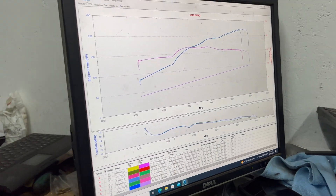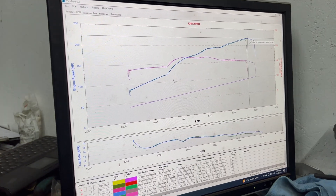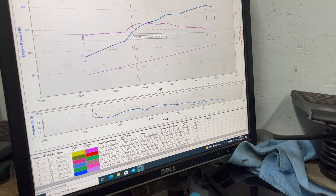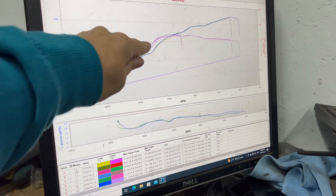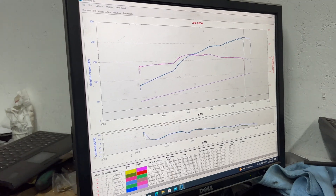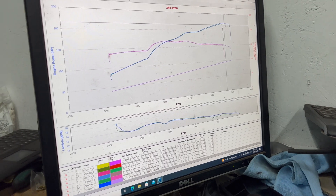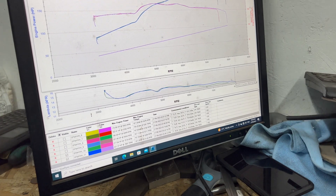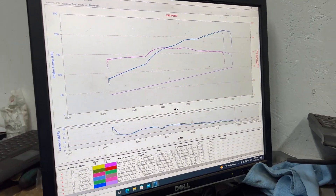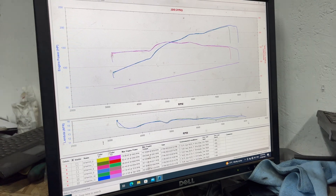Might get to 230 here. It's looking like it is. I wonder what the timing's at, because it's dipped off quickly — I don't know if it's the timing or the cam timing may be under. We've checked that, we'll check the cam timing at the top and have a look on the table. It's dropped off anyway — it might just be because it's so rich, because it is going really rich there, very rich. From seven and a half onwards we'll take a few out and try and smooth and even that out first.